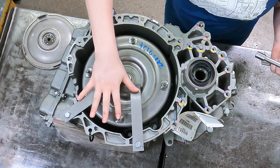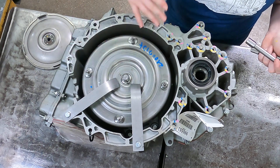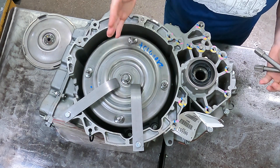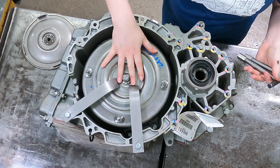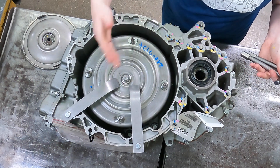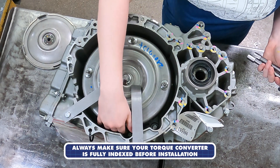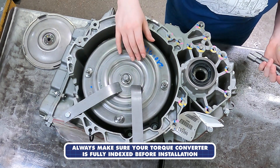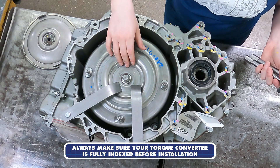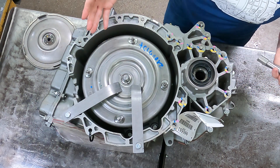You can install the straps back on and make sure that they are fully tight. Install your wrench to hold one of the torque converter studs so that when we flip this back over and get it back onto the jack, the torque converter has not fallen out by the time we are ready for install. It is very important to confirm it is fully indexed by sticking your hand into the bell housing and feeling the pump. Now you are perfectly ready for install of the 6F35.